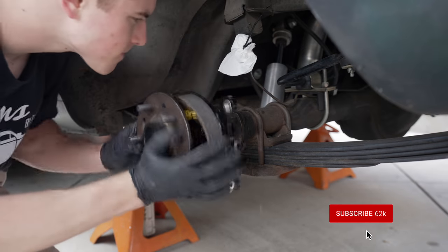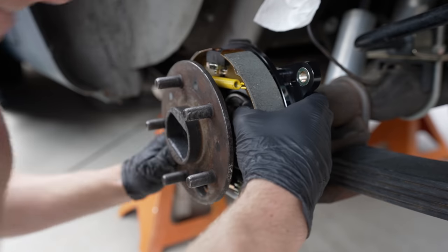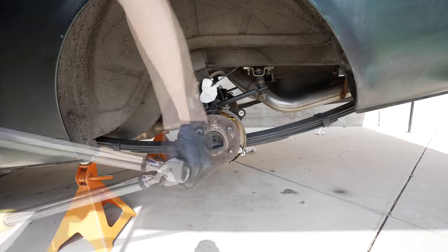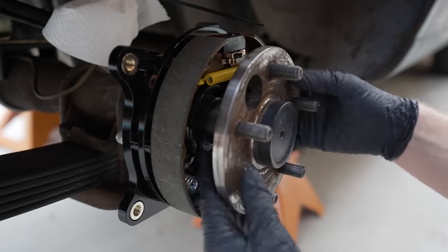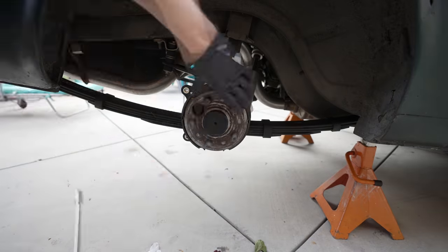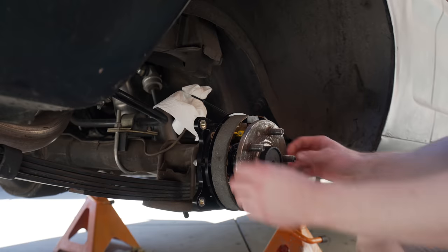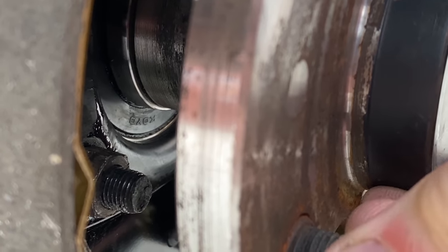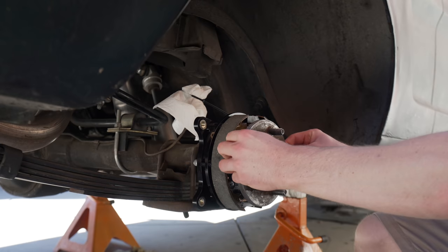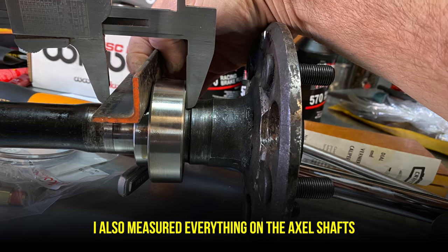The first thing I did was put in the axle shaft with the Wilwood bracket and it went actually very smooth, but then I noticed when I pulled on the axle shaft there was movement — and I was like, this is not good. It was only on the passenger side, and by looking inside the axle housing it looked pretty worn out and it looked like someone had messed with it.